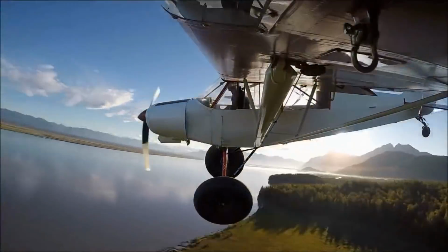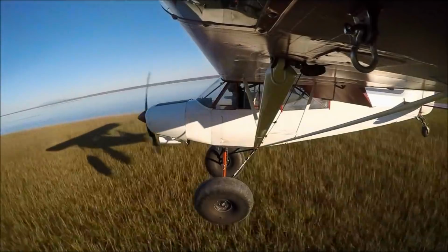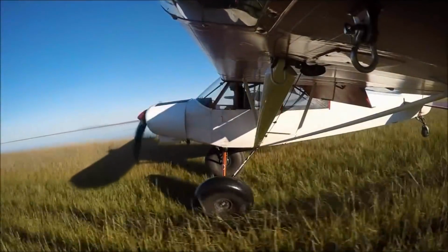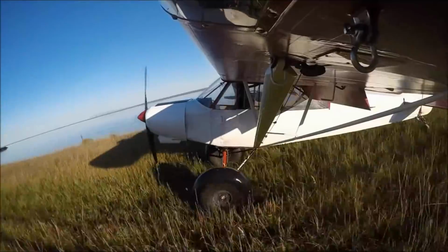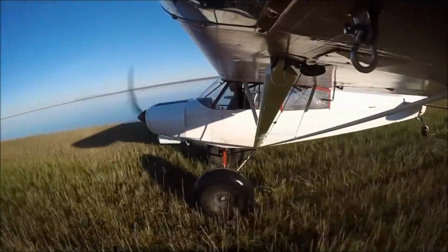All great stuff. So I saw on some of your literature that you've got quite a testing arrangement where you can push the tire down into the floor with hydraulics and drag it back and forth and really stress it. And also, I think it's an electric motor powered very heavy cylinder that you use to spin the wheel up and test your brake products. Sure. So kind of torture testing, it's sometimes called.